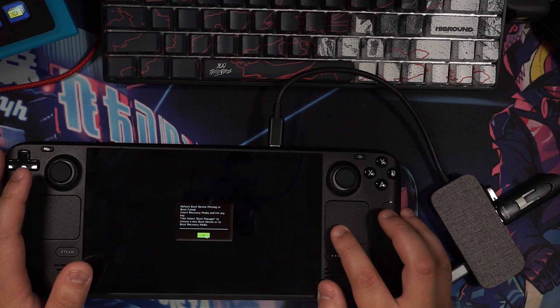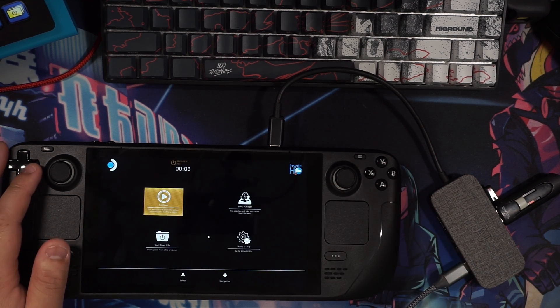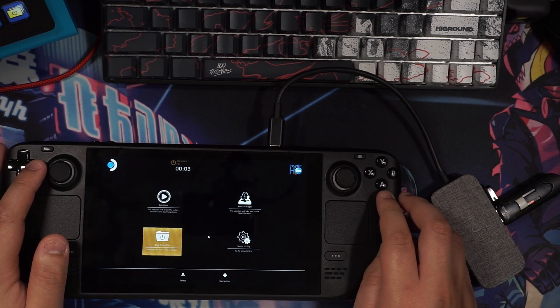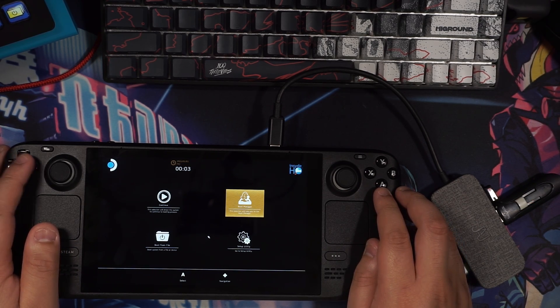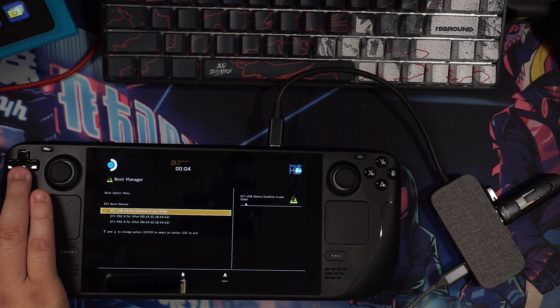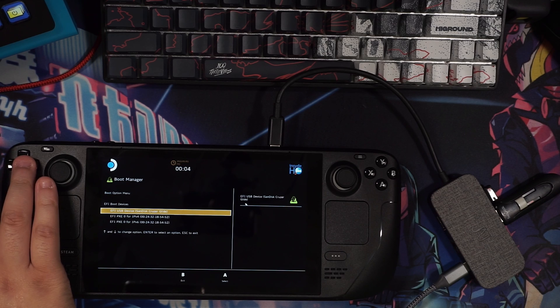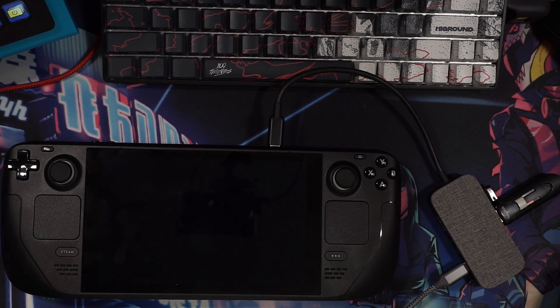Plug it in via your USB-C hub, shut down your Steam Deck, and remove the microSD card to avoid losing any data when reinstalling the OS. With your deck completely shut down, hold the power button and volume down until you hear a chime. Release the volume down and you will be in the UEFI boot menu manager. Select your USB, which could be named EFI USB device, as an example. The screen will go black, but you should be able to get into Steam Desktop mode afterwards in a couple minutes.